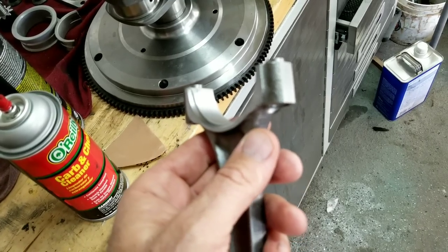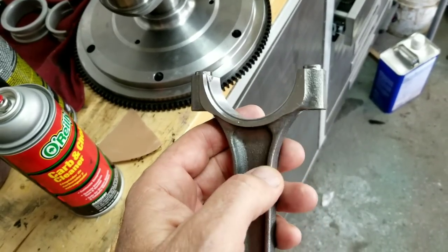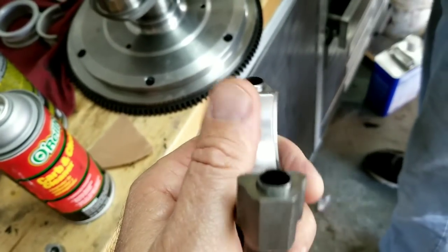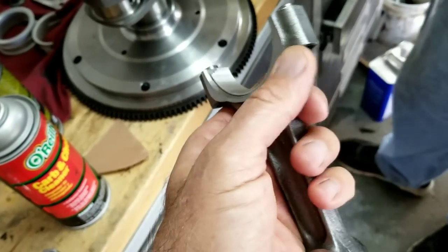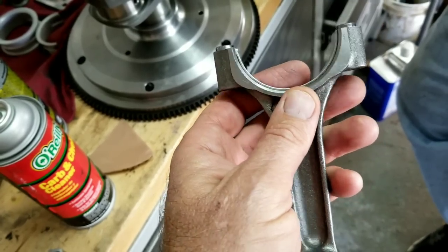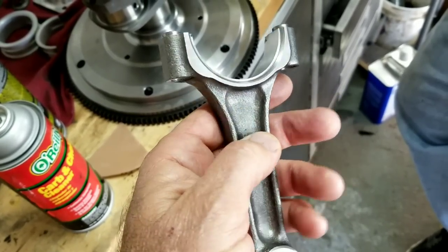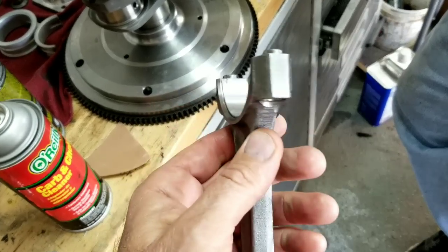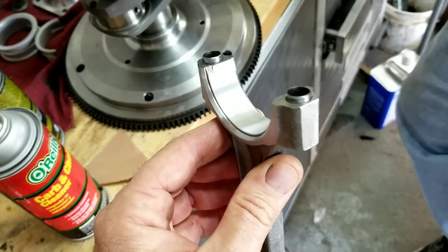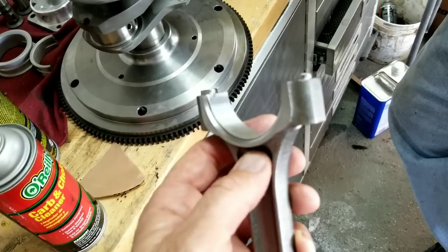This is more of an expert-level thing. If you're not up for it, CB Performance builds these really well, and there's also Brothers Machine Shop local to us — they build a really nice motor and put a lot of care into it. You'll pay a lot for it. We lightly sand the tight spots, then tighten the rods, tap the sides with a hammer lightly to make sure they seat properly, then tighten to torque spec — look that up for the specific rods you have.